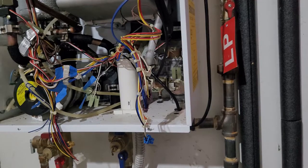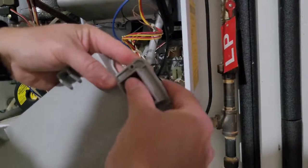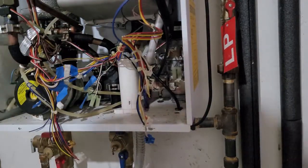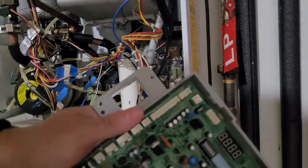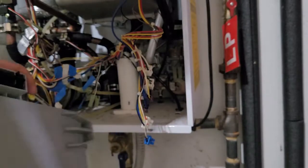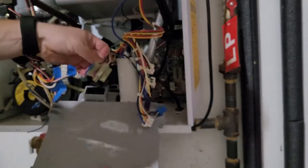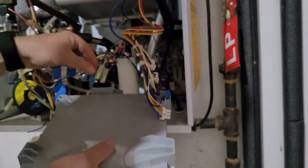You will have to save and reuse the power switch — my board didn't come with a new one. You can pop that out either by hand or with a small screwdriver. After we take that out, we're going to be putting it into the new board, so make sure you put it in the correct direction. Then we'll connect it back up, doing the labeled ones first so I can get the tape out of the way.